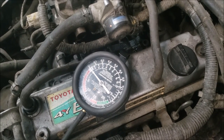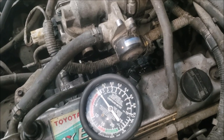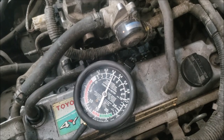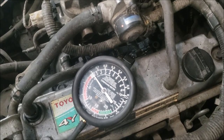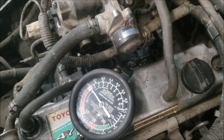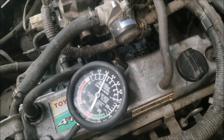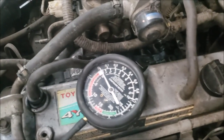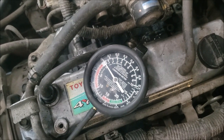Key on — I can hear the motor for the throttle — and then I'm going to crank it. It started a bit easier, although it kind of stumbles at first. What I was trying to do is add more air into the intake.